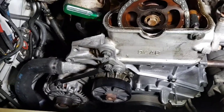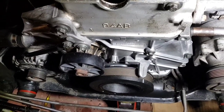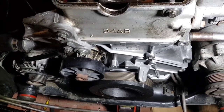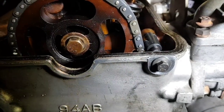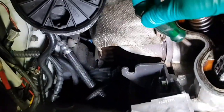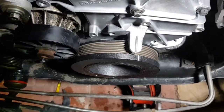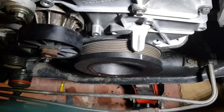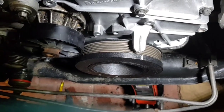So at the moment you can see that little timing mark right there — we are at top dead centre. And that's actually the mark that I made. So if that's top dead centre and that's rotating clockwise, then that mark would be just before top dead centre. I'm going to call that good.